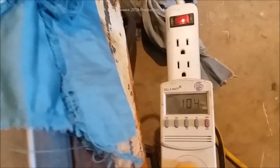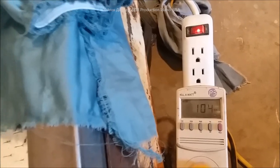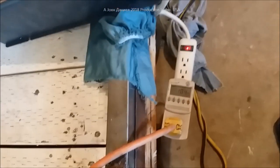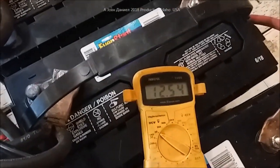With the refrigerator running and the few 110-volt lights - that's just a 40-watt regular incandescent bulb - plus the TV pulling 104 watts, those are things that will run all the time. So 104 watts with 800 watts of solar and a battery bank that'll probably never really drop.